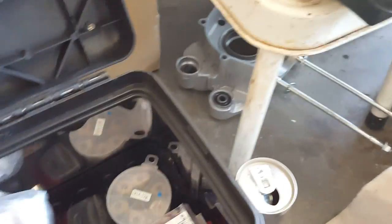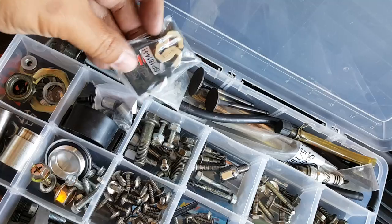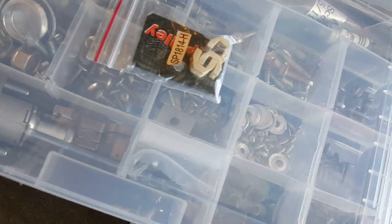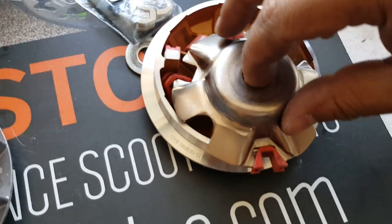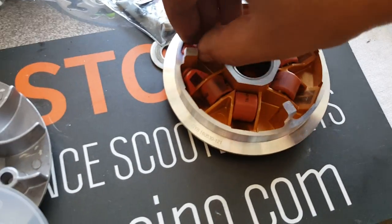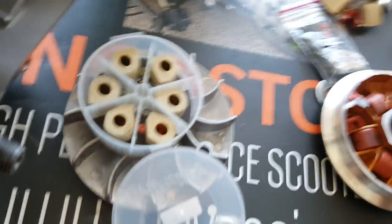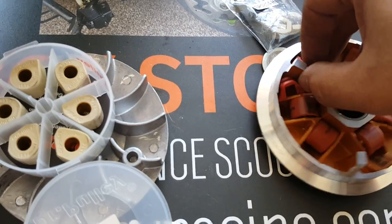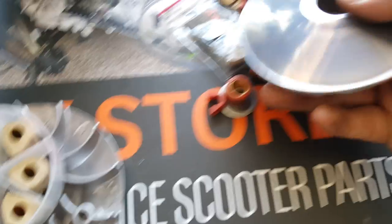All the parts are here — I had them right here, trying to protect things by putting smaller items in components and ending up forgetting them. We're actually going to change this as well to DR Pulley ones. The part number says it's made for size 18/14, same as our rollers. The rollers are universal going in any direction and you can mix rollers, but you can't preferably mix sliders — I tried it and it didn't do much damage, but in the long run I didn't want to experiment further.